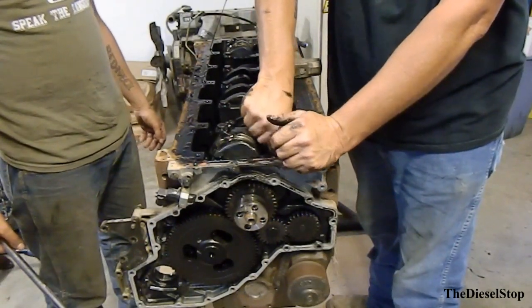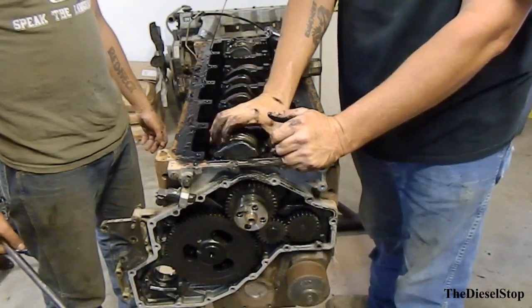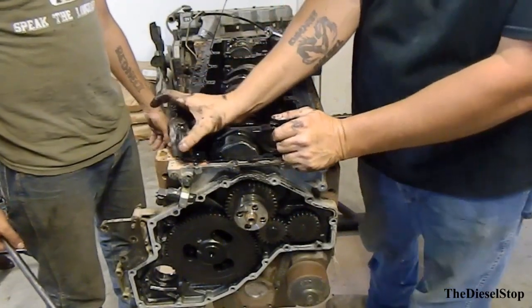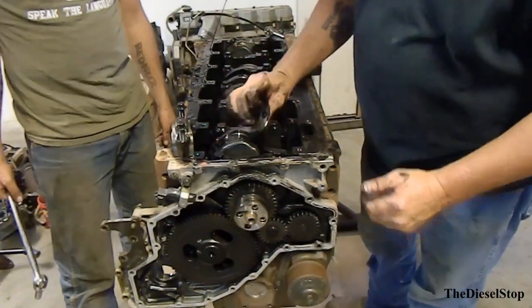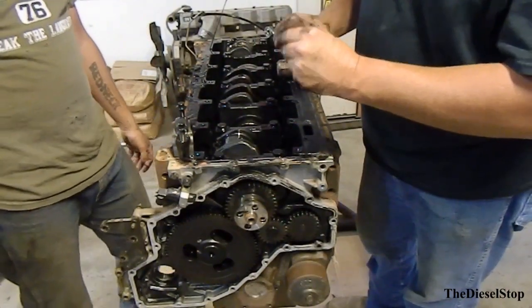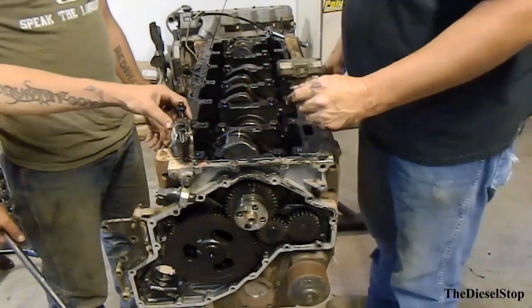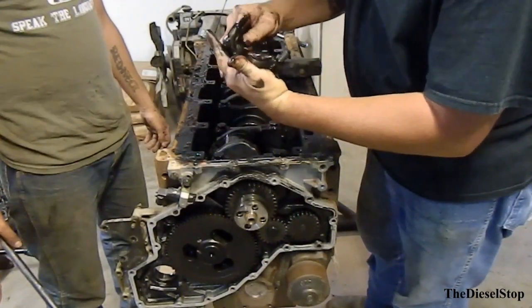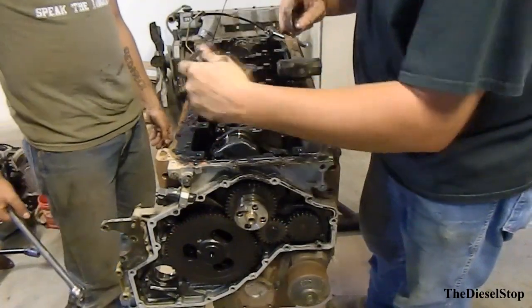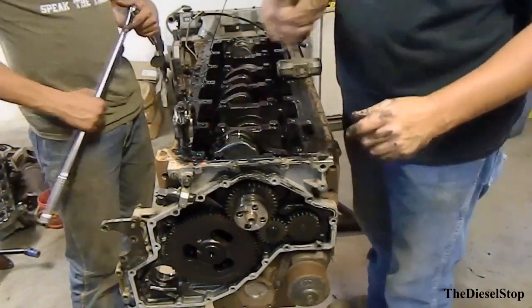Man, you smell the oil, and this thing smells like crude oil. This smells like it burnt off. Smells like it got burnt real bad. Can you imagine that going 15,000 miles on oil? Anyway, well, sure eats them bearings up. People think that extended oil changes are no big deal until you start burning them bearings up. Anyway, let's roll that over, Chris.